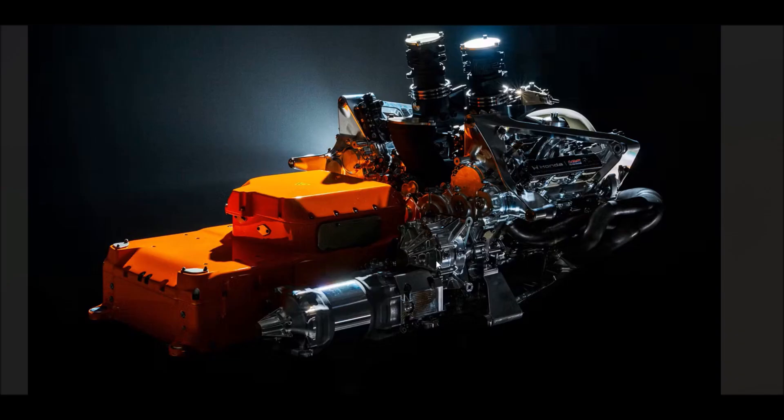If we think about it, most teams don't use the maximum allowed rpm. Let's say the combustion engine is running at around 10,000 rpm — the MGU-K is allowed to run at 60,000 rpm instead of 50,000 rpm in the previous generation. So the MGU-K can run six times faster than the combustion engine, and that's why we have a gearbox between them. You can see all these little gears here to drive the camshafts, and connected on the way is the transmission of the MGU-K. The transmission ratio can be six in that sense. It also makes sense to let the MGU-K run faster because you can then provide more power with less torque, so fewer things can break and the engine can be lighter.